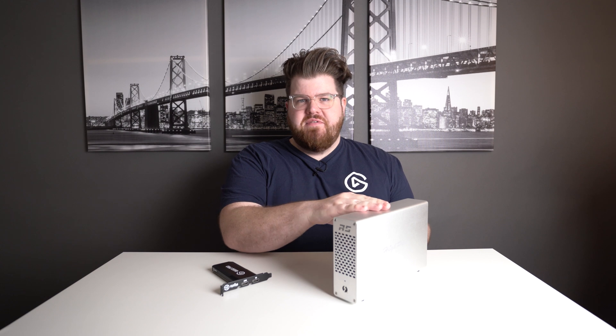One last thing to keep in mind: before getting into this whole setup, make sure your computer actually has a Thunderbolt 3 port. Thunderbolt 3 uses USB-C, just like other protocols, so if you have a USB-C port it might just be a USB 3.1 port and not an actual Thunderbolt 3 port with the full 40 gigabits per second bandwidth. Make 100% sure you actually have Thunderbolt 3 on your computer before delving into this type of setup.